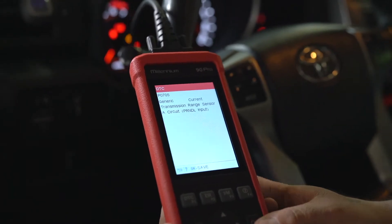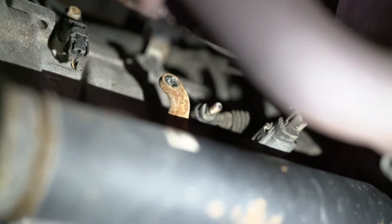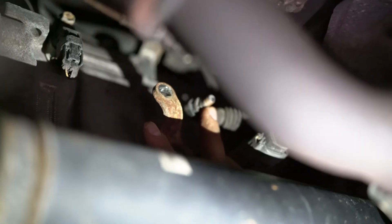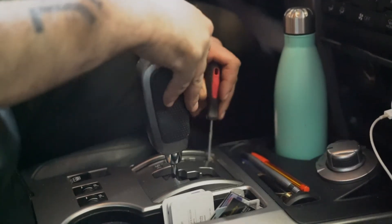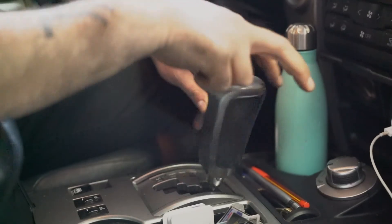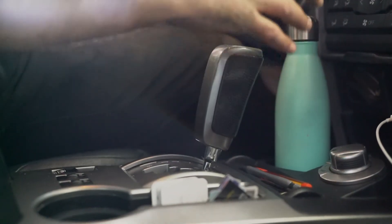Now we're going to lift this vehicle up and visually inspect it. On this vehicle we have a cable that runs from the shifter knob to the side of the transmission. We've disconnected that shifter cable from the transmission end because I want to see how the shifter assembly moves with it disconnected. I'm just going to push down on the shift lock here and as you can see it moves with just one finger. This indicates that our issue is not in the shifter assembly itself or in the cable.